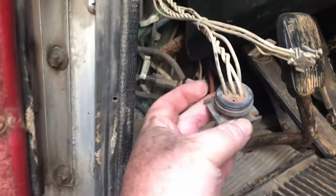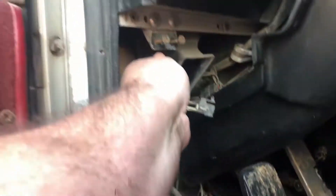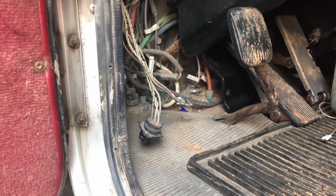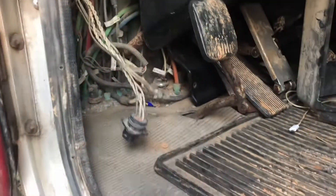Then I decided, well, I have the adapter for the ECM — the 70-pin adapter — so I'll just remove the ECM from the block. Here's what I was talking about: the rivets on the connector broke off. So if you want to plug it into the bracket, it would just push in — you couldn't actually connect it. I took the bracket off and I'm going to drill the rivets out and re-rivet it to the bracket so it works.